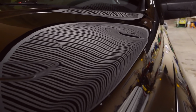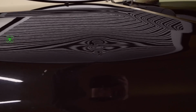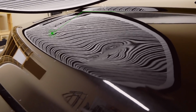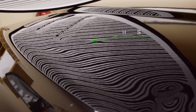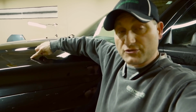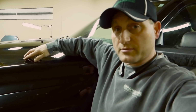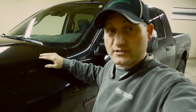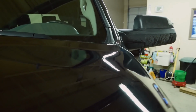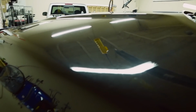So you can kind of see in the before video where some of that damage was spread out past that main impact point that was through here. It definitely went forward and back quite a bit, and then also took out that high spot that was here. Obviously this is way forward, so we know it was stretched to this point because it caught that under brace area and it poked it up. So definitely probably started it wrong, but was able to work with it quite a bit, trying to smooth it out. Had to definitely shrink up the deep part as much as possible.